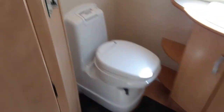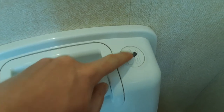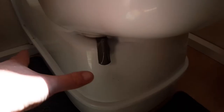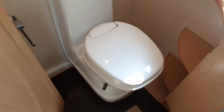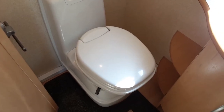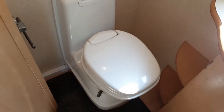Into the bathroom. You have a pump flush on the toilet system — you pump the flush up and down. There is a full indicator light for the toilet waste cassette under the van that will illuminate red when the cassette is full. Down the front of the toilet you have a grey waste handle: when shut it's in this position, when you're using the loo it's in this position, and when you're finished we advise you shut it back off so no smells come back up inside the van. The toilet seat itself turns for your convenience, and when emptying the toilet waste cassette from under the van you'll need to point the toilet seat straight across towards the shower unit, as there are two lockout tabs that hold the cassette in place — if the toilet is turned and the cassette has been used you cannot remove the cassette.